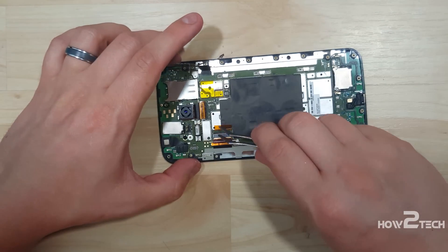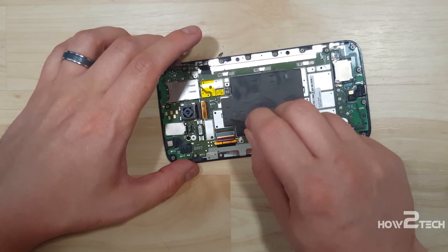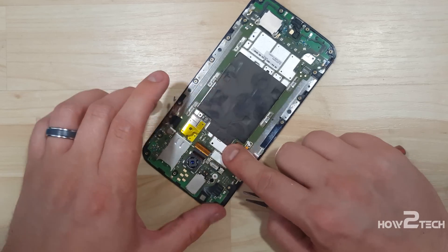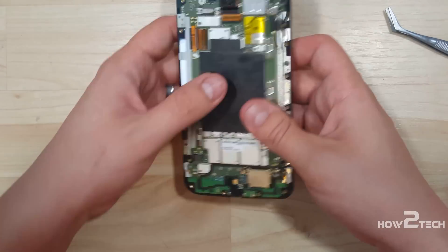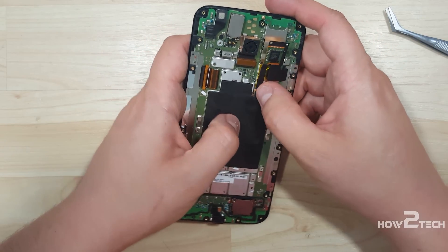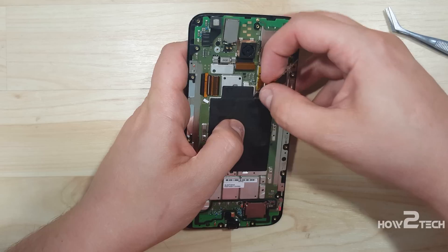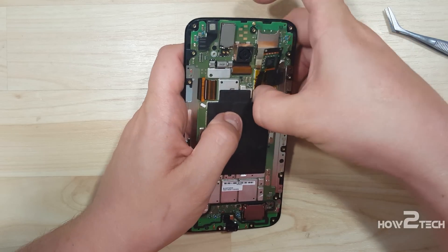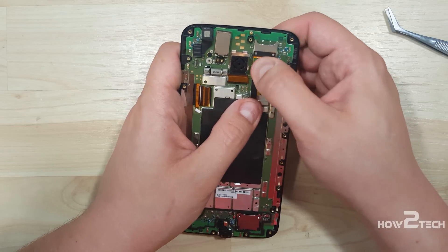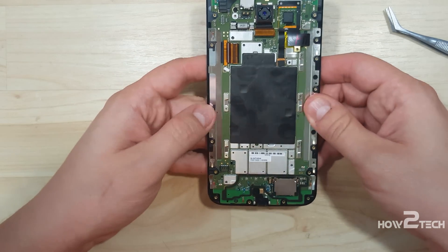Take the tape and put it on top of the cable connector. Then take our touch sensor and snap it back into place. It may be a little loose on the adhesive on top of the SIM card slot — that's okay, just try to get it to stick and snap it back on. It should have enough adhesion just to sit there. Then re-seat the camera back in and make sure it's nice and snug.